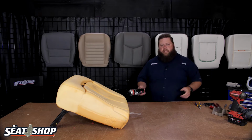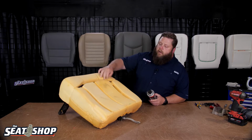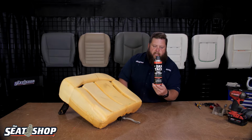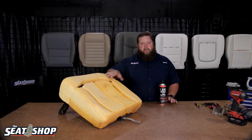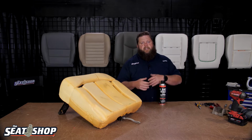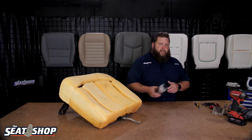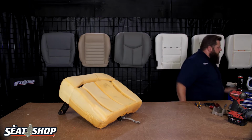Also, I was talking about earlier when I was pulling the cover off, if you do happen to pull the Velcro off of the foam, you want a can of spray adhesive. This is another Amazon item that I just keep around. We also have some different glue that goes in a regular pneumatic spray gun, which is some really good stuff. But this is a good can of stuff to have around when you're doing the install. You can get stuff at Lowe's and Home Depot. I know 3M makes some for foam and rubber. If you do happen to pull some off, make sure that it's set real well. Glue it, let it set real well, because when you put the new cover on, it's going to have some upward tension pulling on it. And if it's not set real well, it'll just pull right off. So give it a good amount of time to go ahead and set up. Okay, steaming.